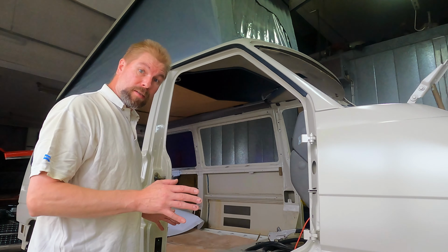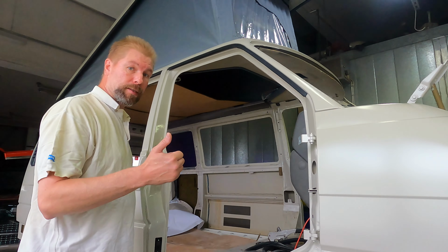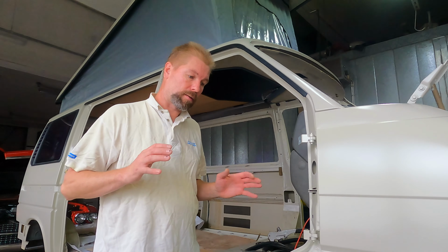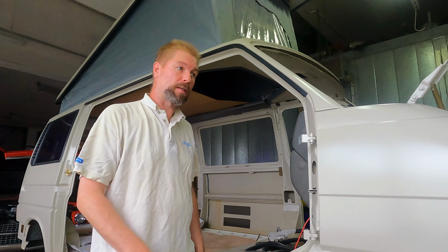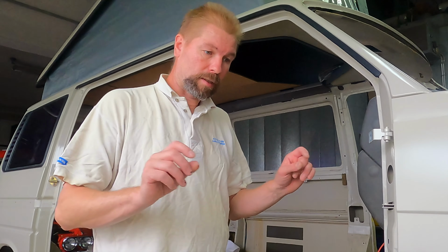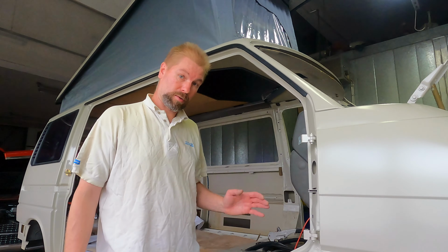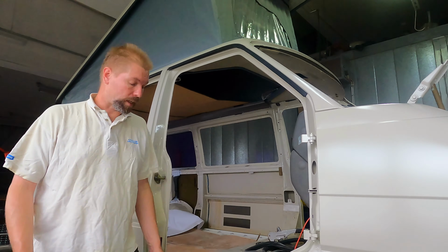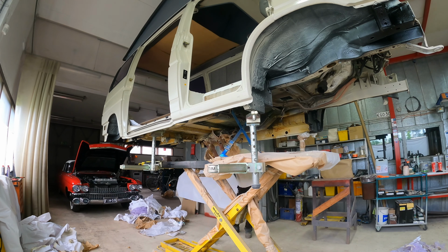Anyway, this painting is not finished yet because I have all four doors and the hood, which are not painted yet. But those parts are much easier. I need to have just some benches where I can lock them for the painting, but as you remember, I already sandblasted the rust off from those parts, so I just need some sanding and joint sealants and priming and paint. So that's much easier than the car body, because there's not much masking and things like that. But now I'm going to take the car up and remove maskings from the lift. See you in the next episode.